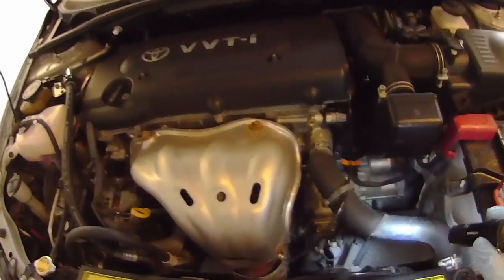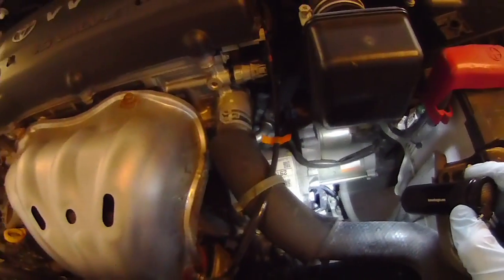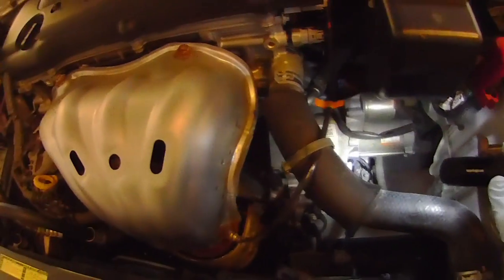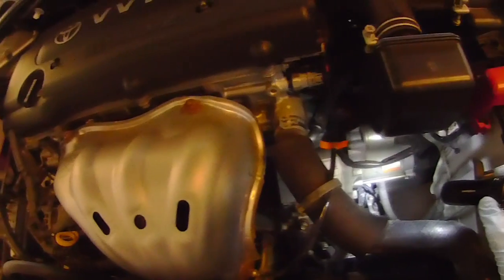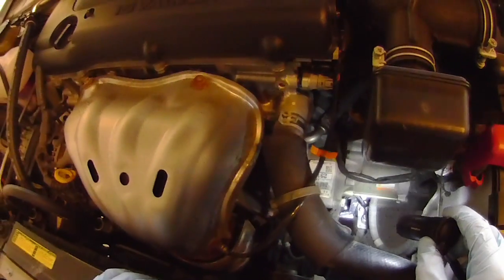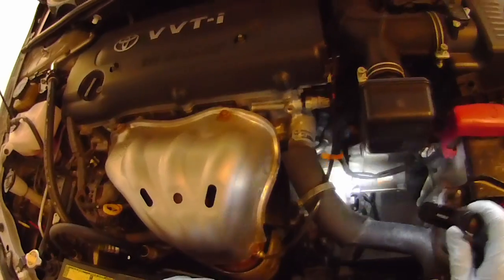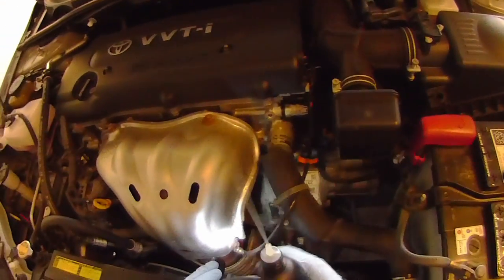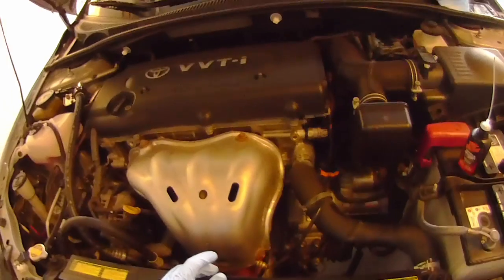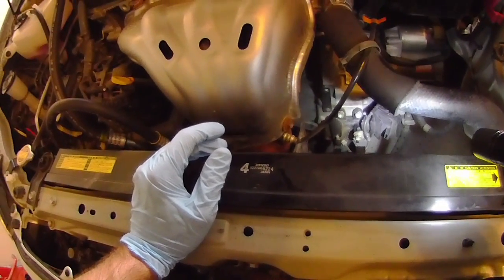Welcome back. It took me about five minutes, but I got lubrication down to the pivot point. You kind of have to reach in there — it's a bit of a trial because you can't really see it very well. Maybe if you get a mechanic's mirror you might be able to really pinpoint it, but it's just not an easy-access job. You'll have to get your hands up behind the radiator and into the area around the slave cylinder and work your way in to actually apply the lube. All I did was take a bottle of Tri-Flow and apply it up into the pivot area of the clutch release arm. You can see the clutch is being depressed and it is completely quiet — there's no noise. It's basically the way it should sound.